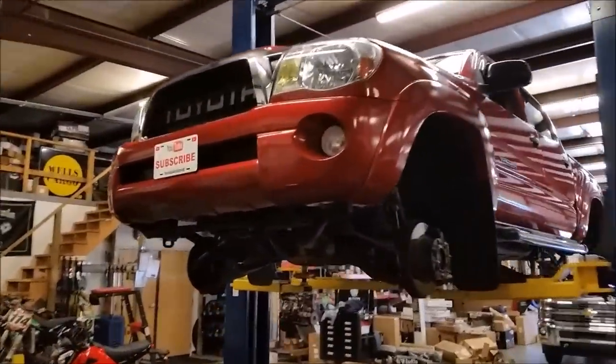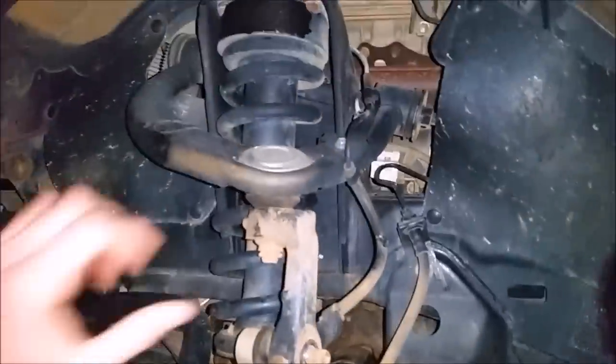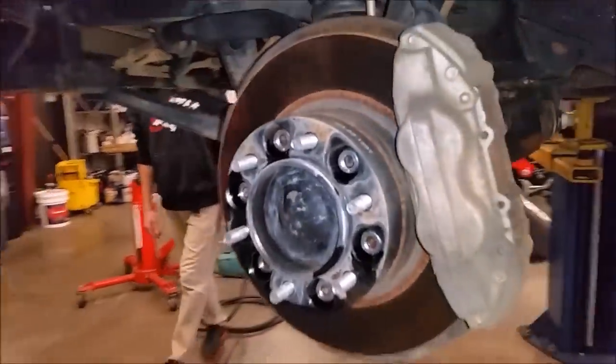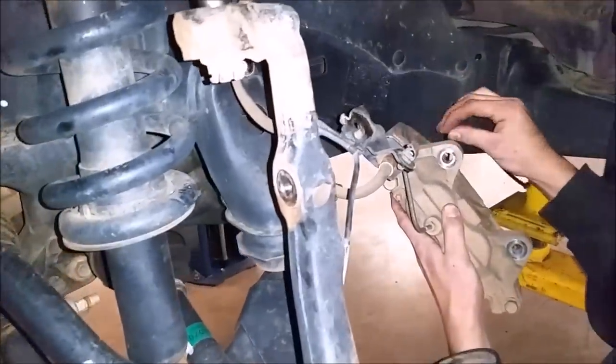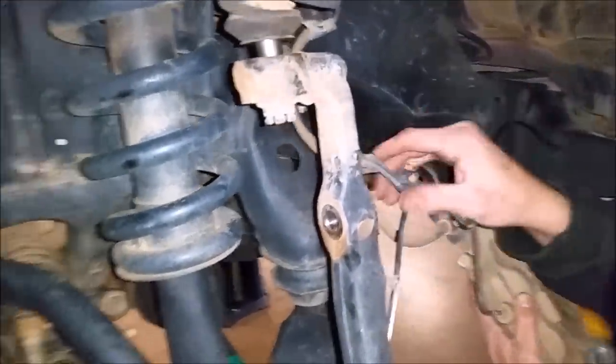Now with the truck in the air, we've gone ahead and removed the OEM skid plate — just four bolts under this right here. Now we're going to start dismantling. On this side we've started off removing the pin right there. We're loosening up the brake line brackets to give a little more wiggle room, and we're going to separate the upper control arm from the knuckle. Then we'll remove our wheel spacers so we can get the hub cap off. The front brake caliper is now off — just two bolts on the back side — and we're going to zip tie it up in the corner to keep it out of the way.